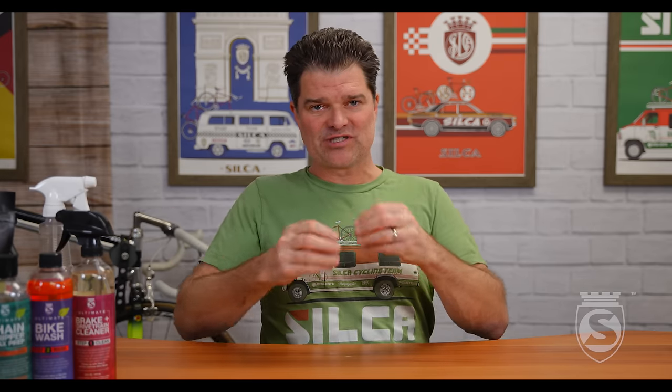When you build wheels, make sure you're using a good anti-seize or spoke prep. And if you have no other option, clean the bike regularly — but remember, wiping is not washing. Wiping gets stuff off external surfaces but does nothing to flush out the salt, ammonia, and other toxins getting into all the nooks and crannies. You really need a wet wash with copious amounts of clean water and ideally a good soap. If you have to use your nice wheel indoors on the trainer, wash it honestly weekly or bi-weekly to make sure you're not having problems down the road.